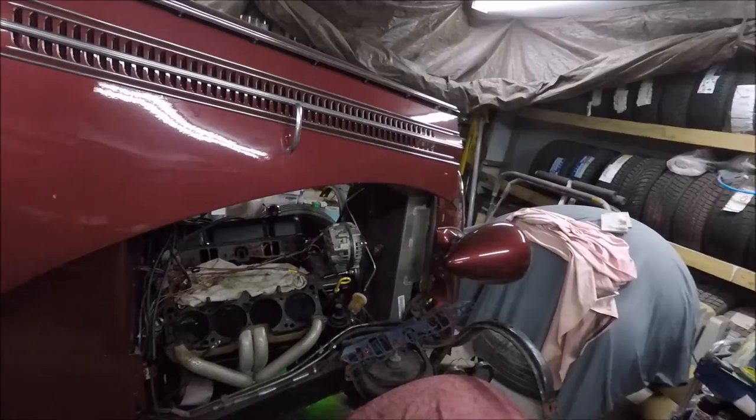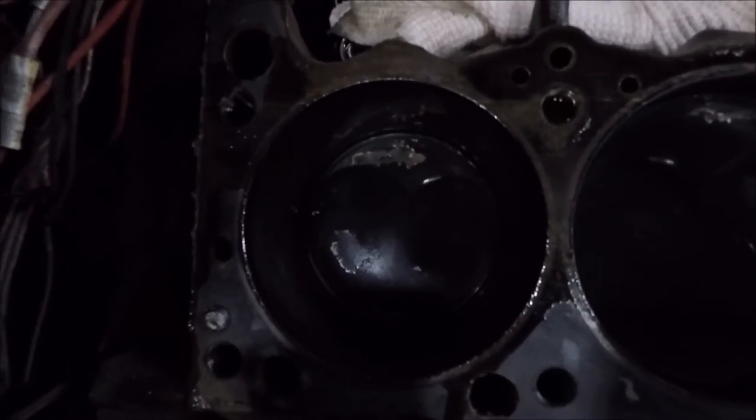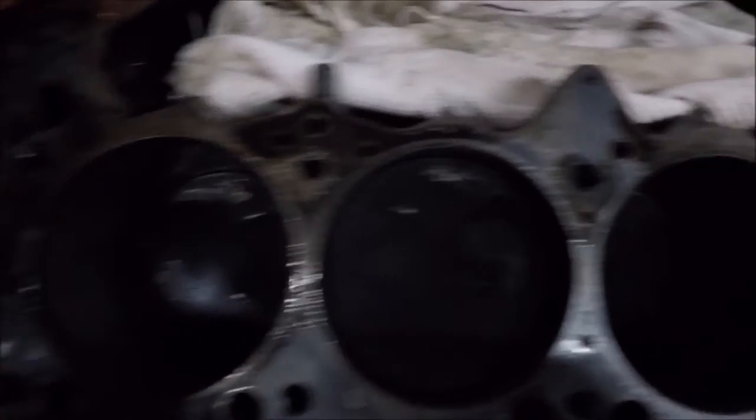The mystery of the ticking in the motor of this '36 Dodge project ended up being — the two back pistons were put in reverse. One in the back should be over here and this one should be over there. The reason for that is because in those flat-top pistons there are little grooves cut out for the valves so that when they open and close they're not hitting the piston. Dad upgraded the cam to a longer duration cam, which leaves the valves open longer. So what that meant was one of the valves was just barely touching the piston when it came up, and the ticking noise was just giving it a little tap, helping it close. Long story short — the problem is solved.